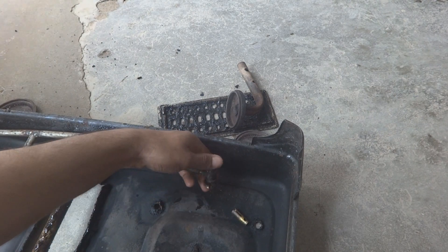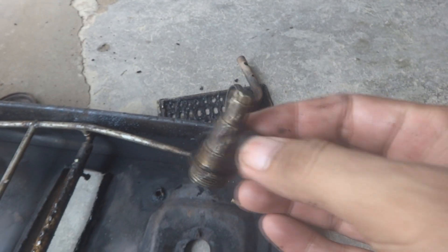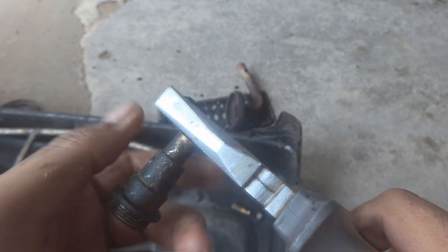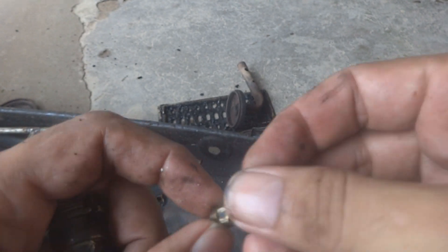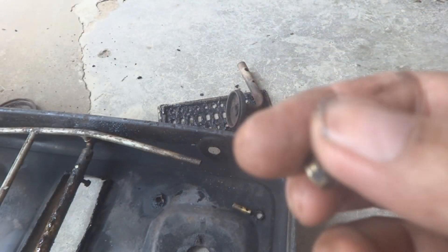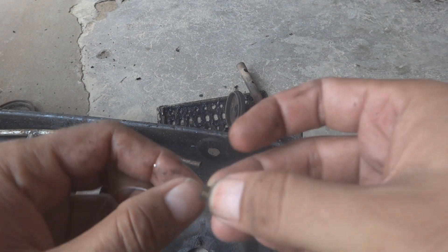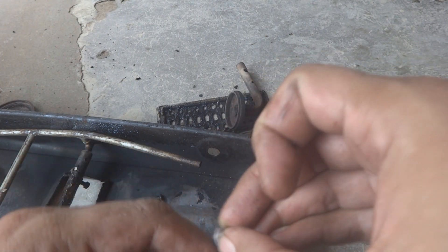So this way it came off, as you can see. Now is the time to remove this nozzle. As I said, there is a nozzle — here is the nozzle — so we will remove this nozzle from the older unit. You can put a new one, but my choice is to reuse this older one because they do not go defective; the aperture is open and it has no problem. We will do a little bit of threading — you can use Teflon tape or anything available, but I am using thread since it is readily available.